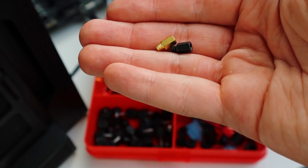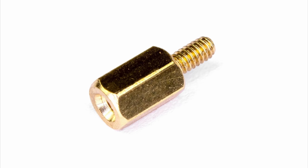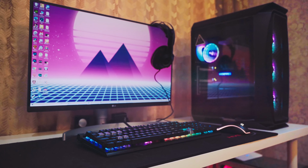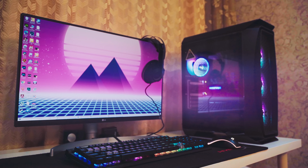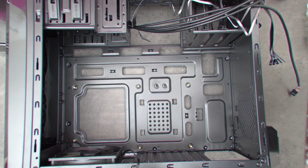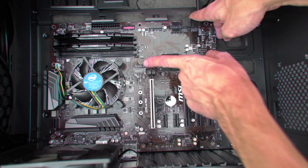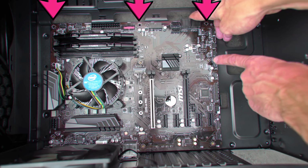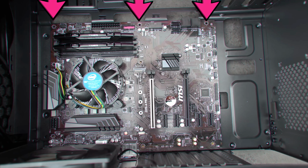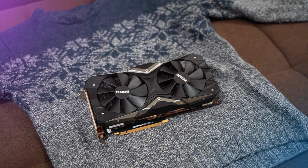Incorrect installation of the standoff behind the motherboard. Short circuit and static electricity. A improperly installed metal standoff behind the motherboard can cause a short circuit of the PC. And this is at least a frozen game and reset of BIOS settings, and at most, something burned out in your computer. It's simple. Make sure that all of the recesses and holes on the standoffs match those on the motherboard. Otherwise, the standoff resting against the textolite can close the conductive paths. Have you already understood what this is fraught with? Also, static electricity. Don't put components on artificial fabrics, sweaters, carpets. It can hit the circuitry and disable it.